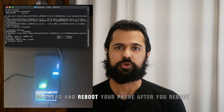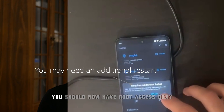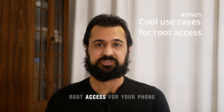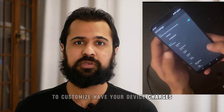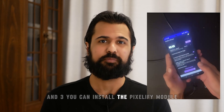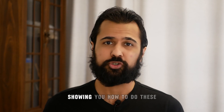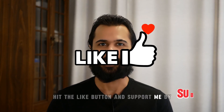Once the flashing is completed, go ahead and reboot your phone. After you reboot, open the Magisk app — you should now have root access. There you have it: your bootloader is unlocked and you're rooted. As a bonus, here are the top three ways you can use root access: one, use the charging controller module to customize how your device charges to maximize battery health; two, use your phone as a Pi-hole to block ads across your network; and three, install the Pixelify module to get unlimited Google Photos storage. Let me know in the comments if you'd like a video on any of these, hit the like button, and subscribe to the channel.